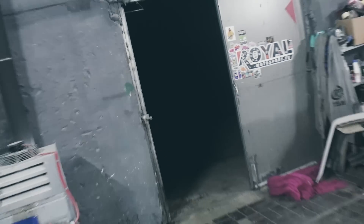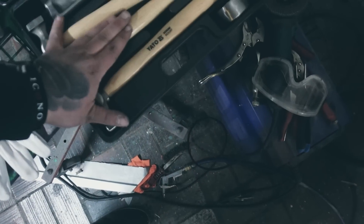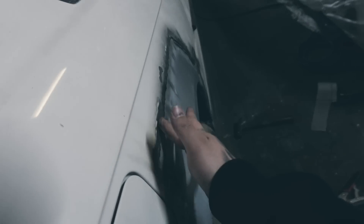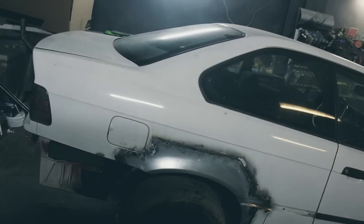Meanwhile it's already dark outside and I'm done with the wheel arch. Hats off to this hammer. I welded so flush but waves formed. We used this body hammer set — no idea what it's called — and it saved our ass massively. We have virtually no waves in the sheet metal. There's just one single wave, right here. I ground a lot here and can't get it out anymore — we'll definitely need to do a bit of filling there. But that's really the only spot. Otherwise it's turned out great and I'm mega proud to have welded in a wheel arch for the very first time. And of course the fight against rust didn't make it easy. Now comes what I'd call the nicest work. Honestly, I'm only doing this once more on the other side — and then never again. It's really taxing, especially fighting the rust.